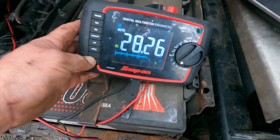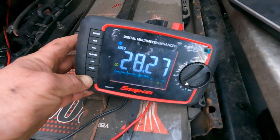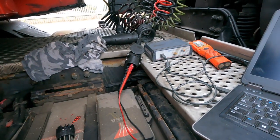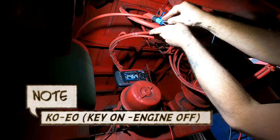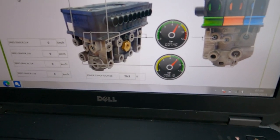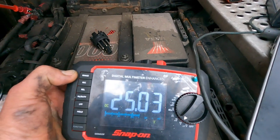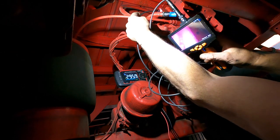What I have here is a high voltage situation - this high voltage supply was too high. The output of the truck was 28.2 volts on the battery and the same for the ISO lead to the trailer. With the vehicle running, the battery is now starting to lose charge but it's 24 to 24.5 volts. This actually says 26 to 27 volts, and just before I went to the back of the trailer it was about 25 volts, so we do have a little bit of a voltage drop.